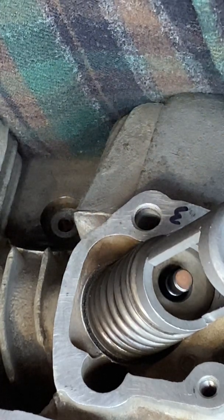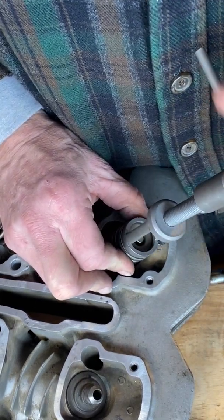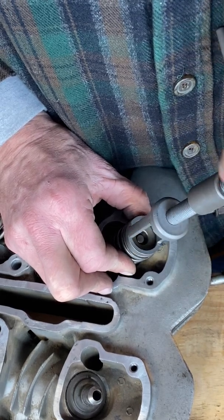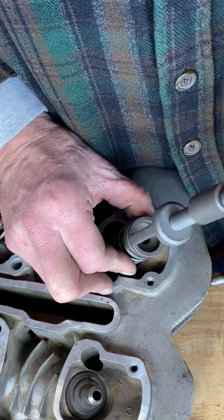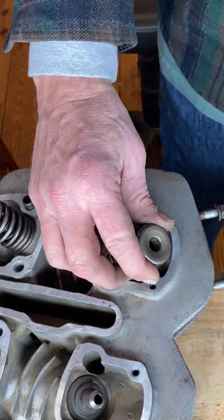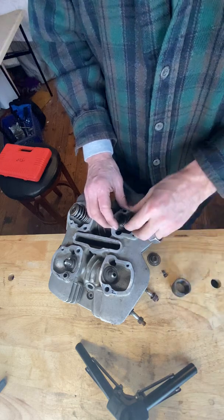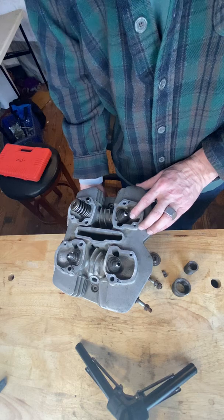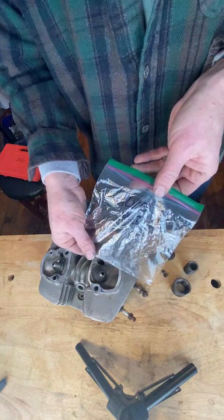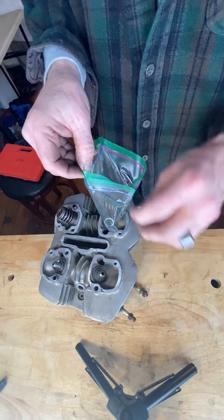All right. Now I can decompress the spring. You see the valve stem lowering back into the spring. Actually, the stem isn't moving at all, but it looks like it is. The spring is growing taller. And tool removed. Spring cap. Outer spring, inner spring, valve, done. This is valve number 3. Valve number 3. 6 items. 1, 2, 3, 4, 5, and 6.